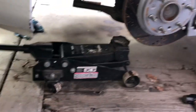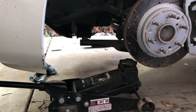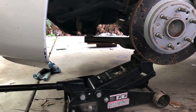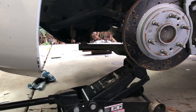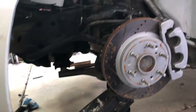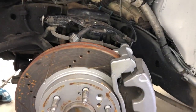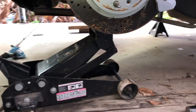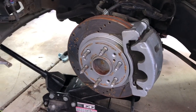This is what I meant by putting the jack underneath the control arm. I like to put mine right underneath the shock where the shock mounts up. That way there's not a lot of pressure on that spindle when you go and take it off. Just try to center it. You basically just want to do that so when you start taking things apart, the spring doesn't try to come at you.